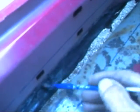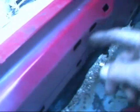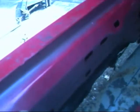And as I say, as long as that stays dry, once I've finished, it won't rust again. And there'll be wax oil inside there, and all the vent holes will be in the sill, so hopefully no more rust, or not for a few years anyway. And the wax oil will go in those holes, as I said. Okay, there's the floor now.